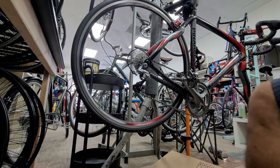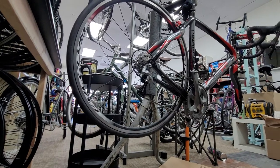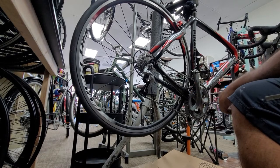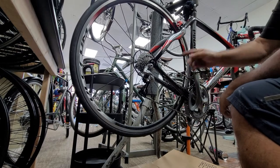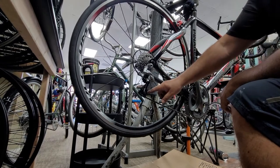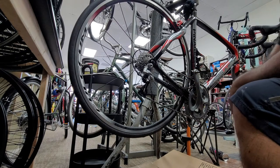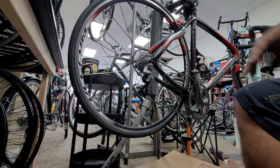Once we've got the bike ready, we're going to adjust the brakes and see how it works. Okay, brakes, everything is perfect. That's what I always say: there are things you need to replace sometimes. The chain ring, the chain more often. Cassettes, they can wait. Pulleys, you replace them after many miles, because the pulleys get loose and wear out too.